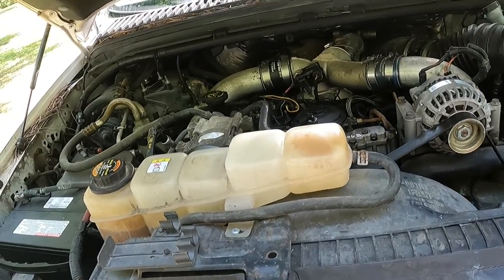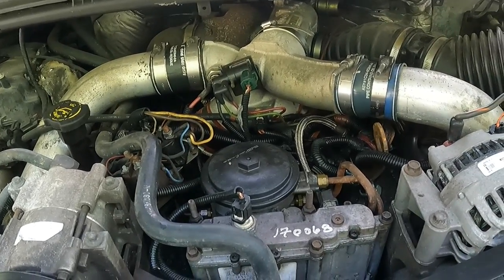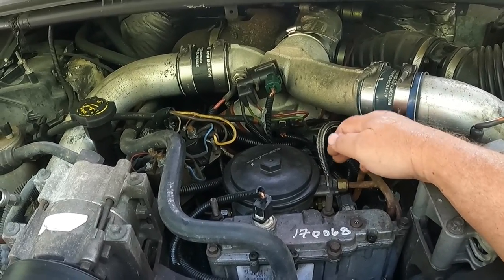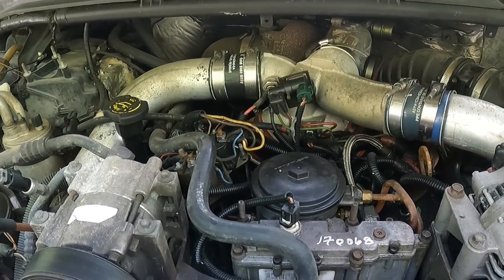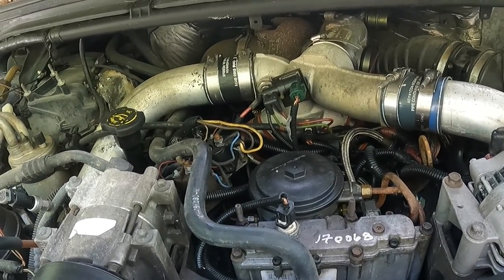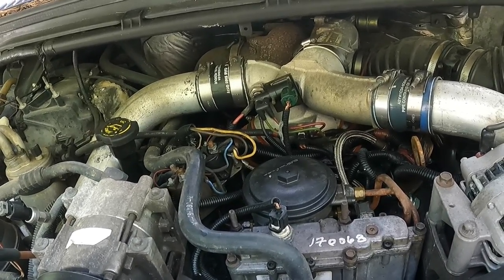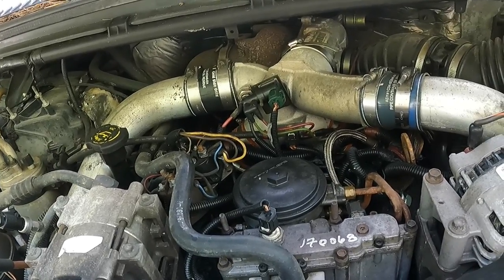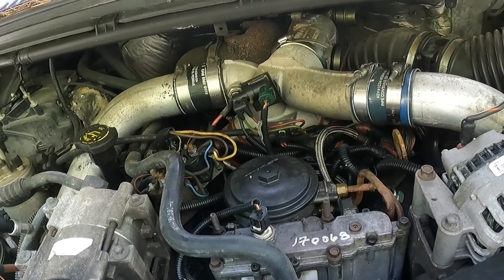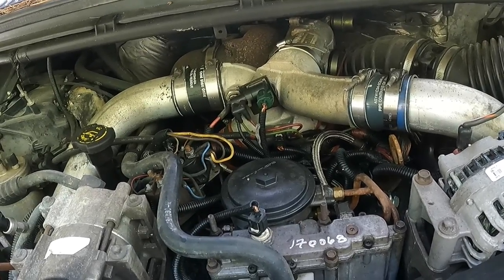All right, so it's been a few days since I got back on this 450. I'm gonna catch myself and you guys up. So we changed the wiring for the ICP and the pigtail, and the wiring for the IPR pigtail that had all the stripped wires and whatnot in it. And I was still getting weird high pressure oil pressure readings, anywhere from 0 to 2200, and a lot of weird low numbers like 200, 150, 75.